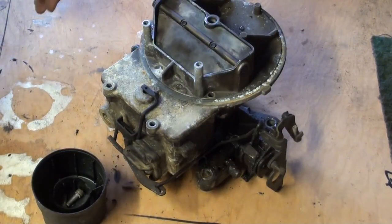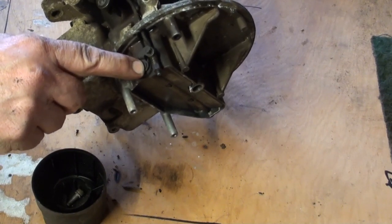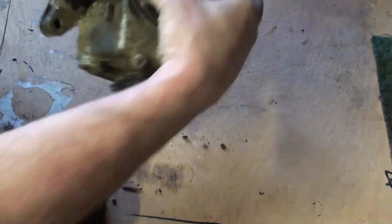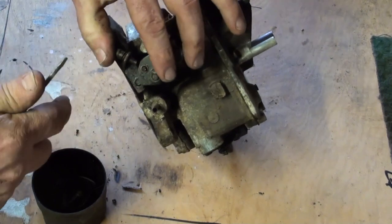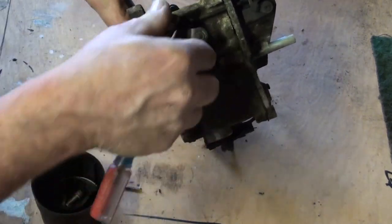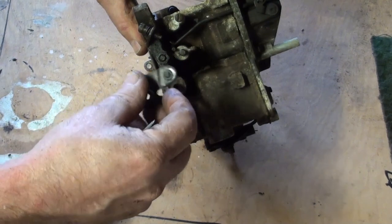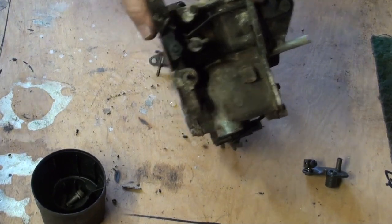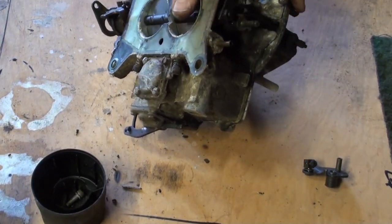Before that happens, there's an issue of this choke — it's peened, doesn't come apart. The linkage rod needs to be turned to a certain degree before it will disconnect. There is an E-clip on this shaft. I'll have to take those out — do that afterward. Back to the top removal.